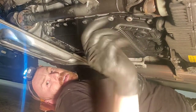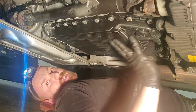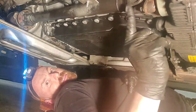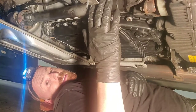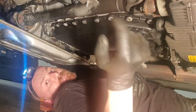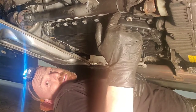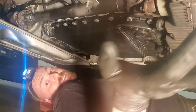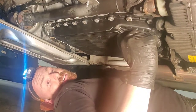Once the cover is removed, we've got to get at — this is the transmission here, and this is the transfer case, and this is the drive shaft, and the drive shaft is blocking the fill hole that we're going to need. The first thing we obviously want to do is crack the fill hole to make sure that we can crack the fill hole before we drain the transmission, lest for some reason we can't open the fill hole and then we're going to be in a world of trouble.